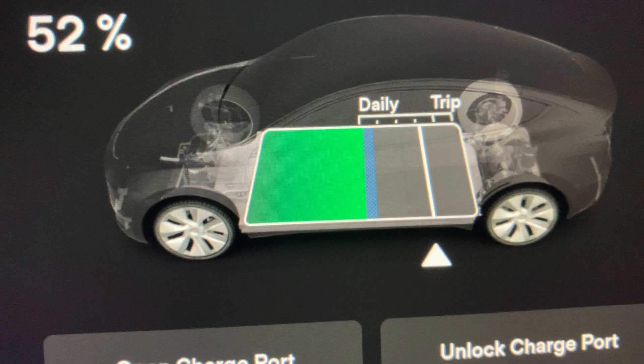So what does this all mean? First, it seems like that section of blue battery in the graphic — the difference between what your car is saying and the app — is the amount of battery it's going to take to warm that pack back up. If you're plugged in and preconditioned, you get that back. If you're unplugged, you're going to lose it if you precondition. Second, according to this test, if you're in a low state of charge situation and need every mile you can get, you're better off skipping preconditioning and just hitting the road. You should get some of that percentage back as the pack warms up while you're driving. But third: if you're in such a low state of charge that you might not be able to warm the pack up enough, you could get stuck in a bad situation. If you're under 10%, you might want to consider looking for even a 120-volt outlet rather than scrambling 20 miles to a Supercharger — that would hopefully get you enough to at least warm that pack up and get that good range back.